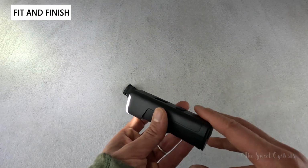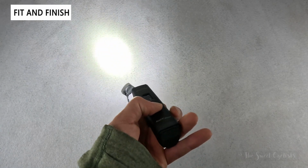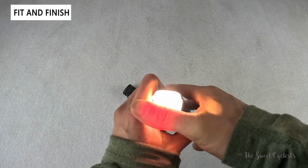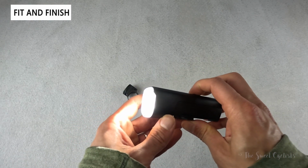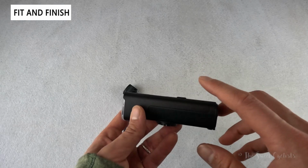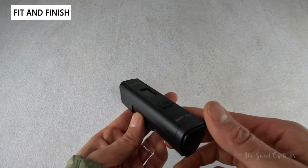You can also use the app to enable the sleep mode as well as the smart mode. In smart mode, the bottom LED is shut off during the day based on an ambient light sensor. And then the sleep mode will use a motion sensor to turn this off after 5 minutes of non-use.